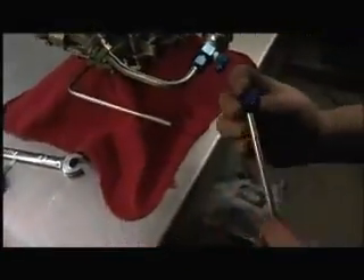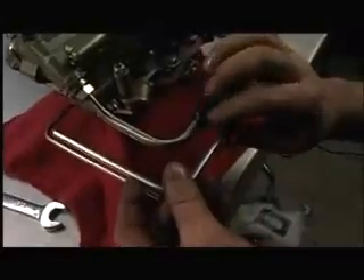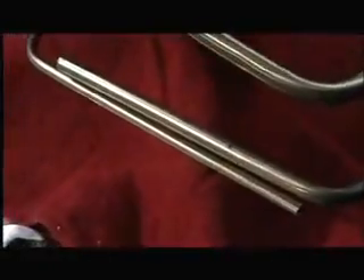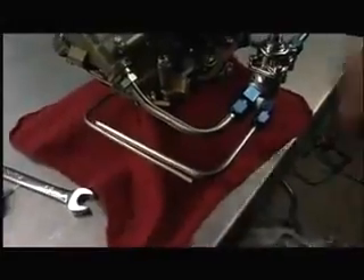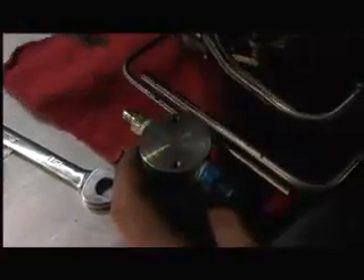Now we're at the point where we're going to mount the fuel solenoid for our nitrous plate. What we're going to do is bend a quarter-inch line — that'll be our feed line for our fuel solenoid. On the outside of it will be three-sixteenths line, which is a number three. When we're all finished, the fuel solenoid should sit approximately here; we'll feed it and come out right into our jet. I'm only going to cut one at a time to make sure everything fits — measure twice, cut once.